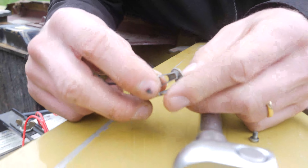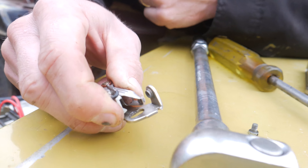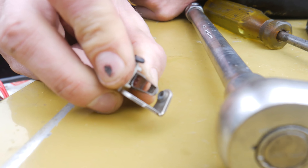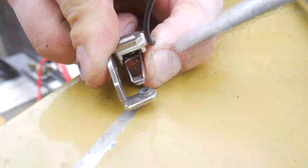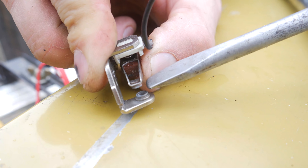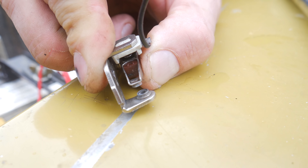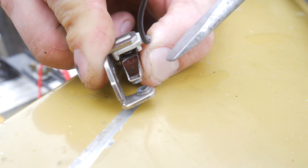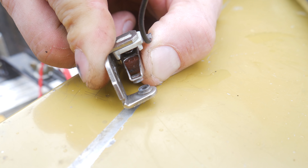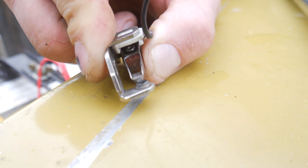To inspect the points, what you can do is actually open them. As you can see, it's cupped — it's actually worn into the material over time. We've still got a little bit up the top here to play with, but we could mess around for hours trying to file that back down and we're never going to get it right. So those are the old points obviously.